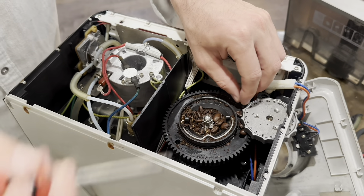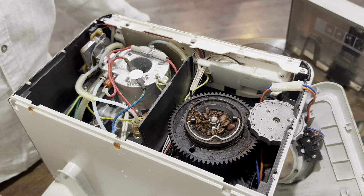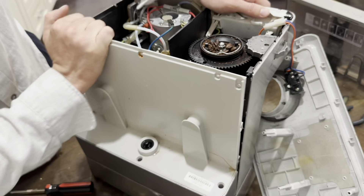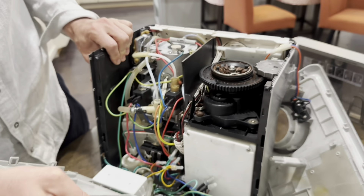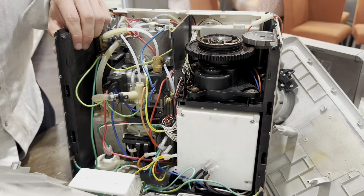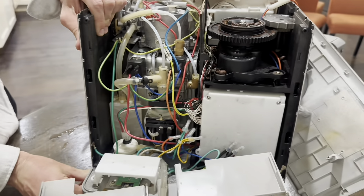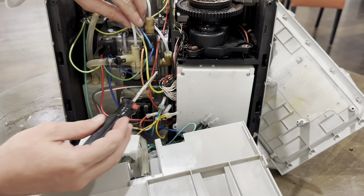Here I am removing the cover, and I'm just going to collect some excess beans that fell through. Next I'm going to pop off the back and access all the components behind the machine. It's actually quite wet here — I spend a little time wiping and clearing out some of the moisture. I'm pointing here to the elbow piece that was implicated in the leakage shown earlier in the video.